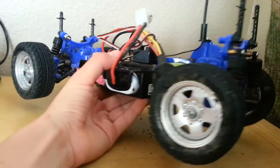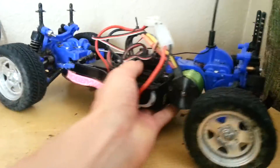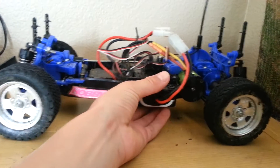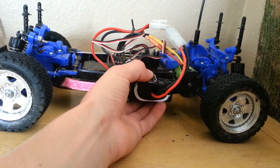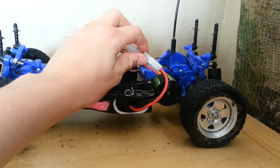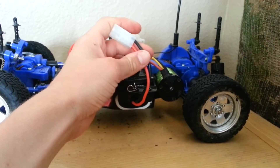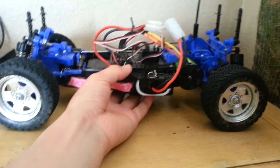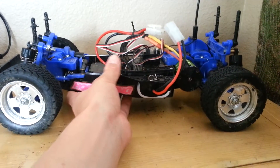So this is more of just a basher vehicle. I would recommend not putting a brushless motor in it. I'd recommend using either a sport tuned or a GT tuned motor from Tamiya if you like that kind of power — maybe an Arma 15-turn, but nothing special. The Trinity motors are pretty good too. I'm also running the stock Molex connectors — some people call them Tamiya connectors, but that's incorrect, they're called Molex. It just can't handle it; it's a basher vehicle. It's great for a beginning RC driver, but nothing you'd want to race.